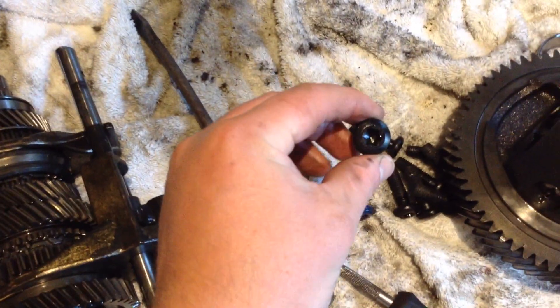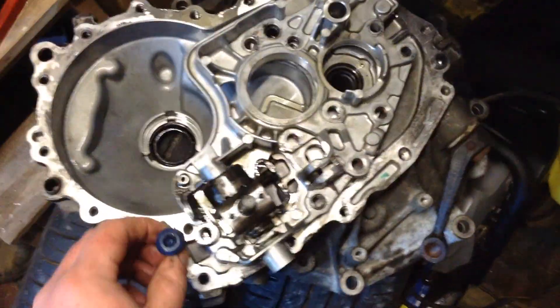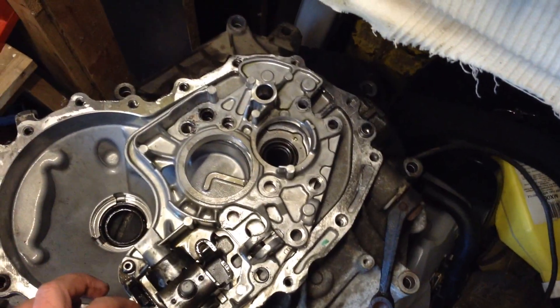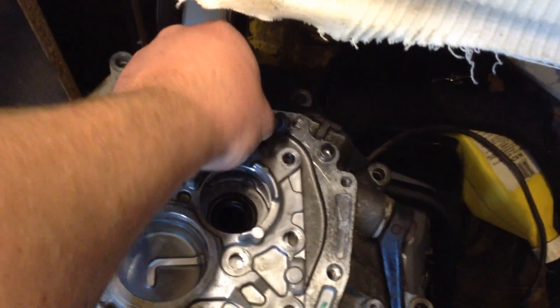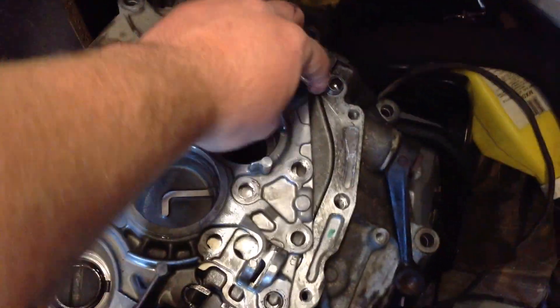And various bolts — there's loads of these. Heavy duty Torx bolts, no thread lock. One of them has a blue head — the one with the blue head goes in this position here. The rest of them, the normal ones with the black heads, just go all the way around, except these two: 10mm head bolts, which go there and there.